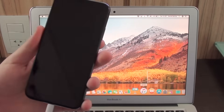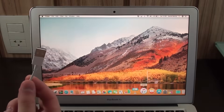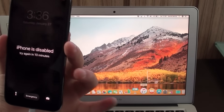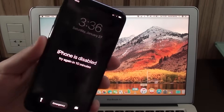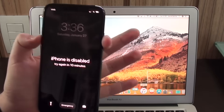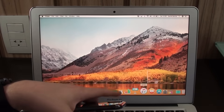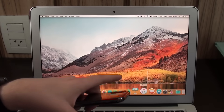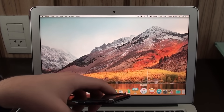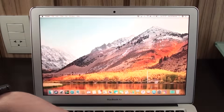If you have an iPhone 7, the process is similar. Plug your cable to your phone and to your computer. Then all you have to do is hold the power button and hold the volume down button — hold both these buttons while plugged in, keep holding, and after about a minute or even less than that, you get the iTunes pop-up saying your iPhone was recognized in recovery mode. This covers every iPhone until the iPhone 7, including the pluses: 6s plus and 7 plus.